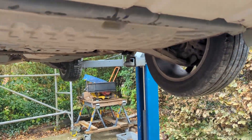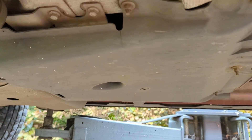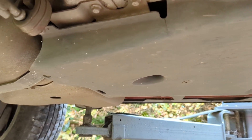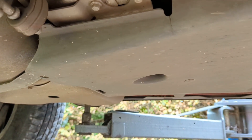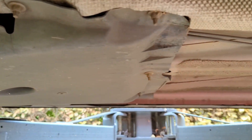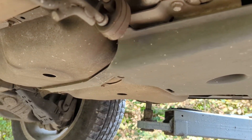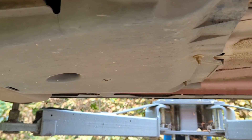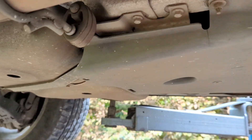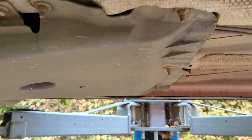So where's the DEF tank? DEF tank is up here. The received wisdom is to drain out the existing DEF — the DEF, or AdBlue as it's called, has only got a finite life and it does deteriorate. The rate at which it deteriorates will be proportional to the amount of air and moisture that's above the fluid in the tank. It's only got like a year shelf life. When it gets near empty — which this one is, it's not empty, but it's near empty — the quality of the fluid could deteriorate and that could be one cause.